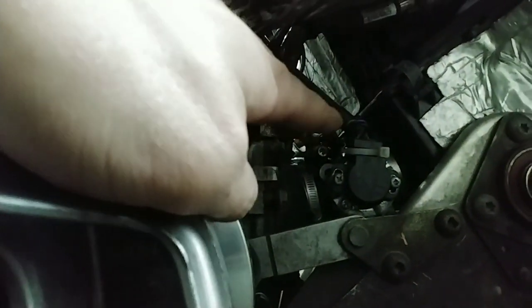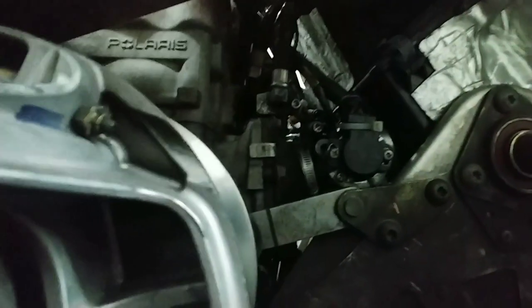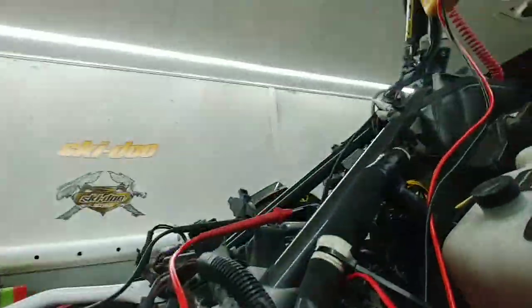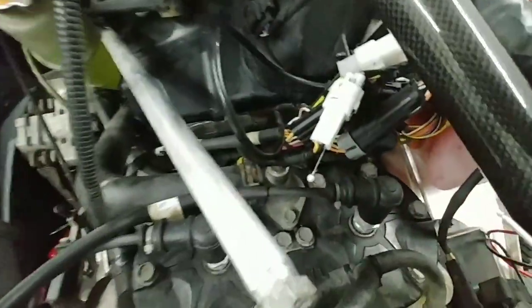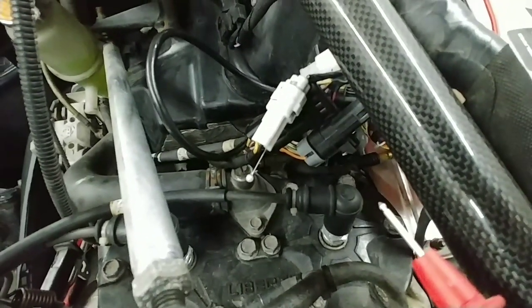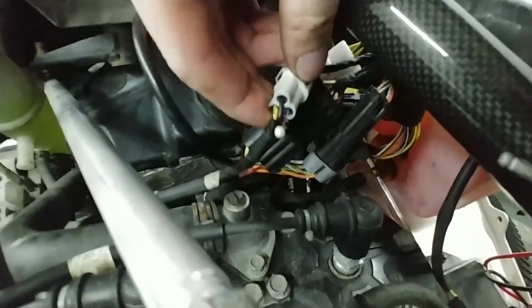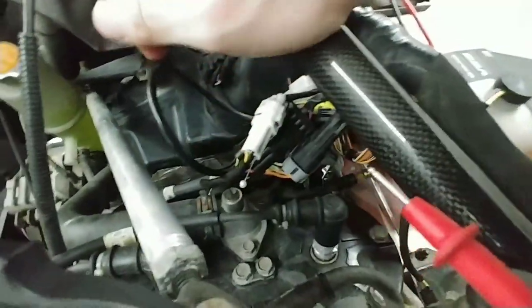Most guides want you to pull your clutches and go down to the throttle position sensor and back-tap those wires to get your voltages. But if you just relax a little bit and come up here, you can tap them at their connector to the ECM right under the hood. What I've done is simply taken one of the girlfriend's safety pins and just slide it in right along the seal — you can get in there without damaging the seal.